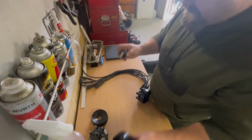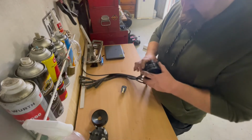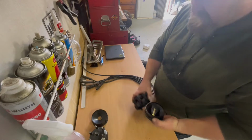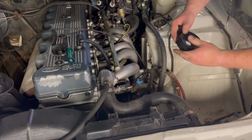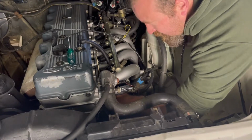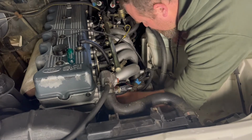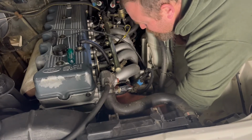We've got our new rotor button and our new mid piece. Should be much better suited for sparking. Alright, so I'll pop this base cap on first, make sure it locates. Yep, that's it. Rotor button can only go on one way. So you turn until he pops down. Should be something around there.